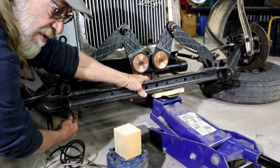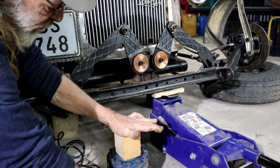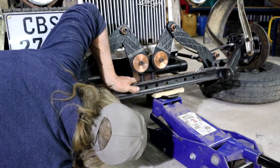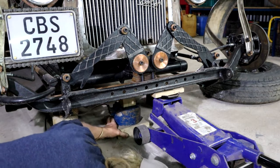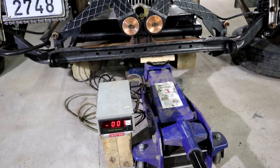I've got some safety blocks in there. The plan now is to move the load cell in to a point where I can rest the complete front of the car on top of it and get a readout. The front end of the car is resting completely on the jack. I've got the load cell positioned underneath the chassis at a point where when I lower the jack, the whole front end will rest on it. The readout is currently reading minus 10 kilos, so we will just add 10 kilos when we get the actual final measurement.